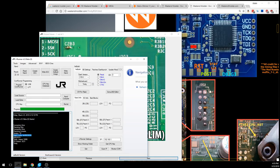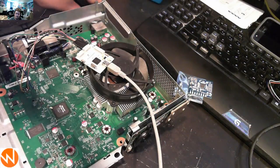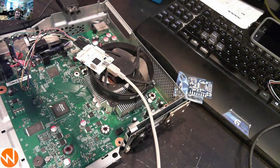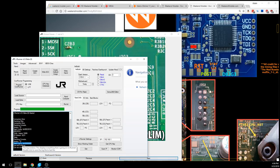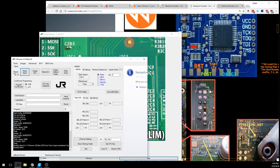Here's a quick test: I'll disconnect standby power and hit the Query button again — you'll see flash config showing all zeros. This can indicate bad soldering, bad connections to the motherboard, or lack of standby power. Reconnect the standby power, hit Query again, and now I get a good flash config and see 'Trinity' confirmed. I'll hit Read NAND, which will do two NAND reads, and we'll fast forward through that.